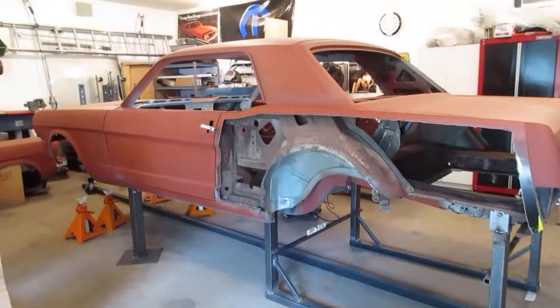Which will allow me to locate the trunk drop offs, the rear braces, the tail panel, all of the rest of it just as it's supposed to be. I think that was a really cool idea — I'm glad I was able to steal it. I just got that finished; I've been working on it for a couple of weeks. I got the quarter skins off, as you see. I'm going to replace full quarters just like I see in Joe Daddy's videos, where he comes in under the joint of the lead to put the quarter panel in there, matches it up, and welds it that way.